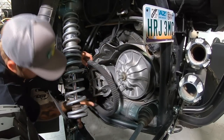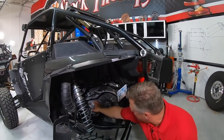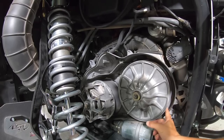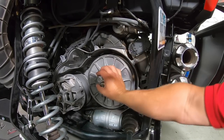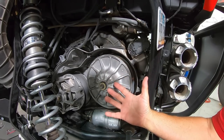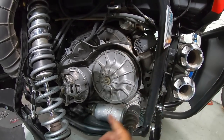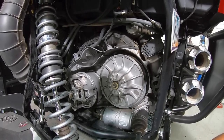You're removing parts and pieces if the belt's blown up. There are probably parts wound up inside the secondary or primary clutch, or behind both of those — between the clutch and the inner primary. They can get stuck in the cooling passages, get stuck behind the secondary, and wrap around the trans seal, causing the trans seal to fail. They can wrap so tight you won't even be able to move the clutch. The best thing to do is pick an end of the frayed belt and work your way around unwinding it — it'll get longer as you unwind. Do that one piece at a time.